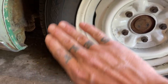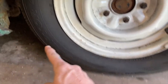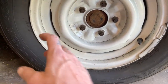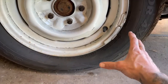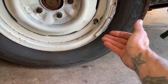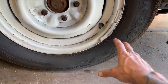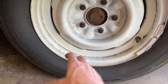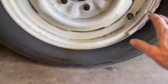We can sand it down relatively smooth, mask it off, and make a tape line with electrical tape so it'll be nice and perfectly round. We can paint this strip white with Flex Seal, Plasti-Dip, or any of those elastomeric polymer sprays - it's rubber, you're spraying rubber on rubber. If you spray regular paint on here, maybe the next day or two days later it's all going to be cracked everywhere. Then that's going to allow the rubber to breathe into the paint itself, changing its molecular - it makes it brown, it'll turn like a dirty tan, off-white, darker than that tan-brown.